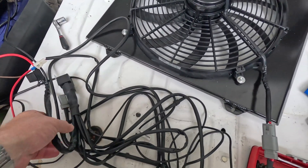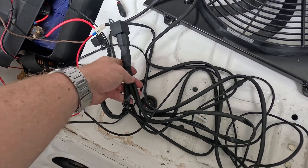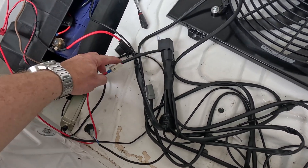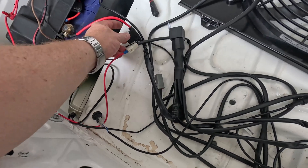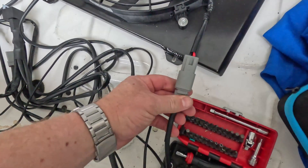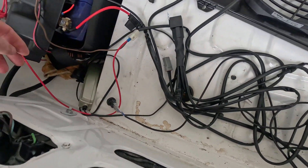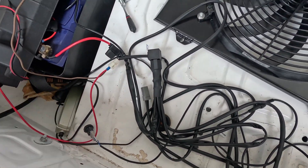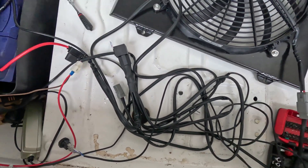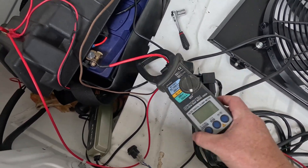Regarding all the fan power and plug - ended up finding an old harness for some high beam. This is a 60 amp relay with a built-in power supply and an inline fuse - only got a 30 amp blade fuse in it at the moment. I ended up just cutting the plug off that and putting it onto the fan, so that's a pretty serious waterproof connection. I'm basically rigging this up just to test it and see if it'll work before installing it all, and making sure the wiring and plug isn't going to melt.